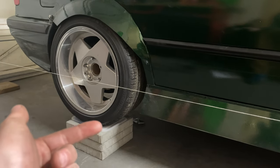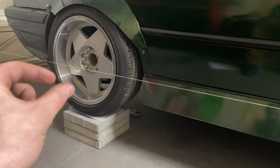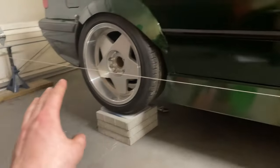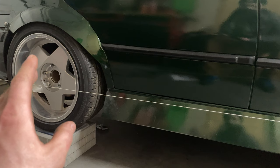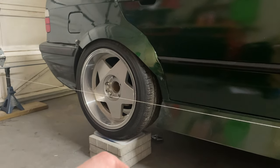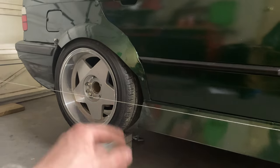It's super easy to do — I have the Nerp Tech offset mono ball. I just have to drop the trailing arm, take the bracket off, pull the little offset shims out, put them on the other side, put it back together and reinstall it. Then I'm obviously going to have to re-square the car all over again, and then I should be able to get some toe in. I'm going to check the other side too — this car has been crashed a couple of times, nothing super bad but a couple decent hits, so I'll check the other side. If I have to do it, I'll do both at the same time so I don't have to square up twice.